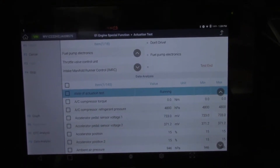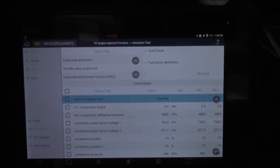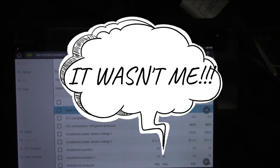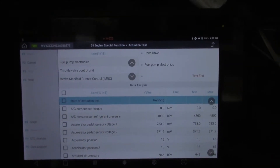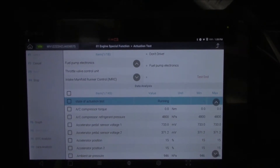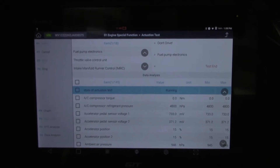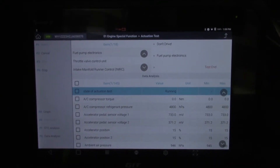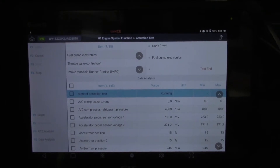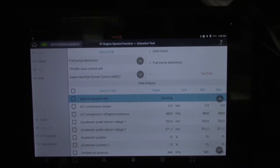That'll do it a few times. Can you hear the pump slowing down as it gets going? Fuel is being forced through the system, and I'm hoping that should be OK. The pump sounds like it's a consistent sound now. Before it started off very fast and it's slowing down now. It's slowing down because it's moving fuel, which is non-compressible. Whereas before it had air, and it could compress all that air so the pump would run faster. So I'm pretty happy that the system is primed. The only way to find out is to start the engine.